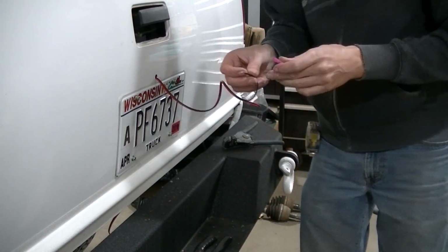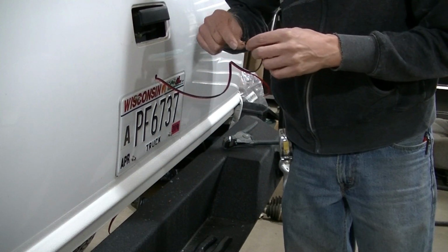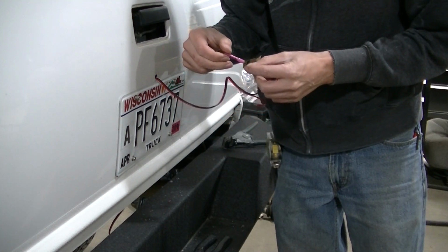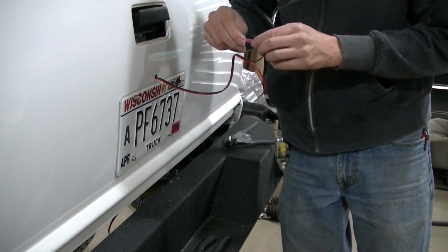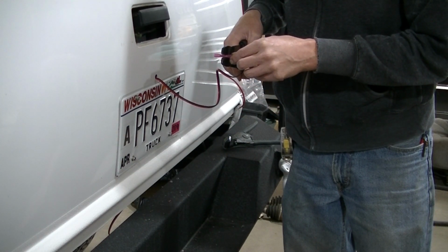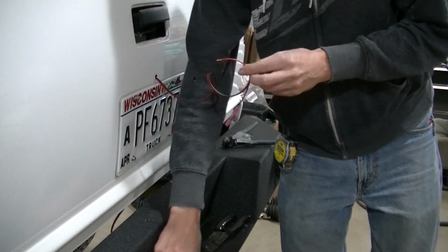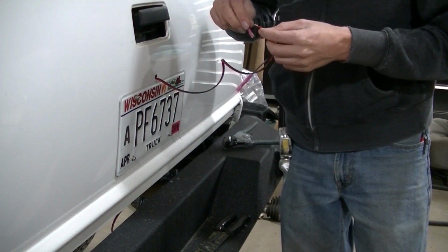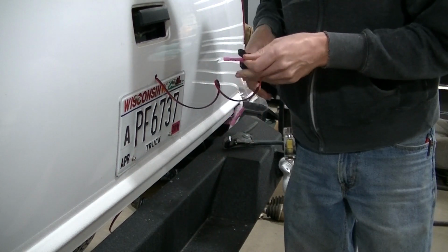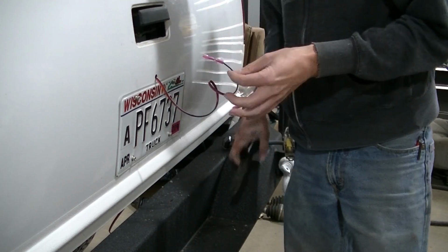Okay, so you saw I got my wire through the tailgate. It's pretty easy. Gonna wire it up now. Gonna use my favorite type of connector, just a butt connector with the weatherproof shrink tube already on it. These are great for outside where you're going to have all the salt and junk trying to destroy your truck and your electrical connectors. This is really small gauge I'm running here. This is a very small light, shouldn't take much power at all.